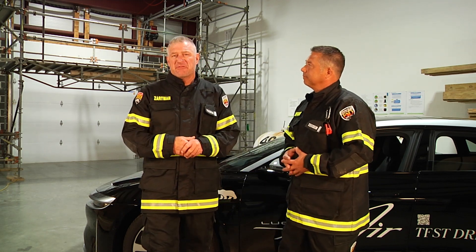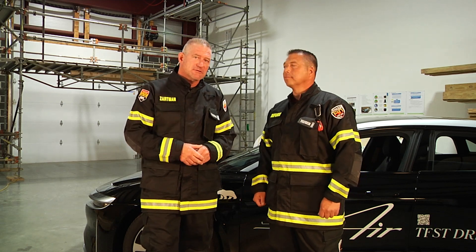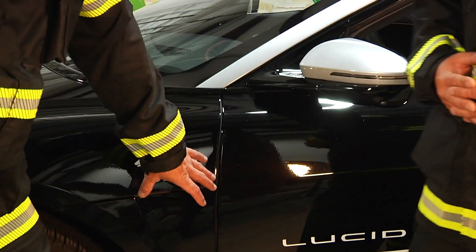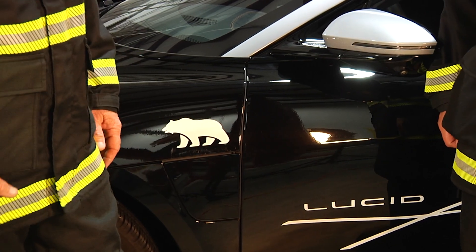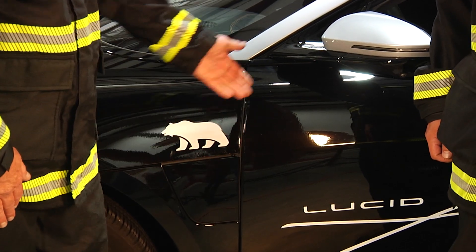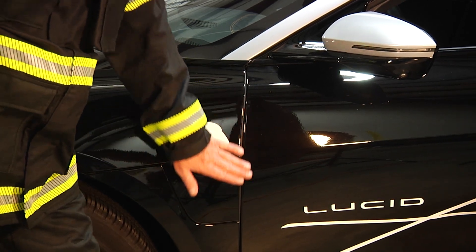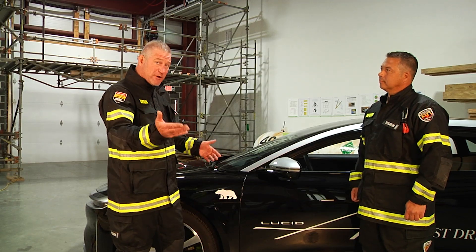Here's what first responders need to think about that's different from normal combustion engine vehicles. First and foremost, let's identify whether or not we have charge ports or high-voltage components close to the doors. In this example, we've got a charging port with high-voltage cables right here on the fender skin and the A-pillar. A common move for us as first responders is to crush this fender line with spreaders to open up this gap and gain access to that door hinge. But if we look at how this is designed, any pressure points along this fender can cause interaction with the high-voltage cables and the charger. So we're going to need to rethink this.